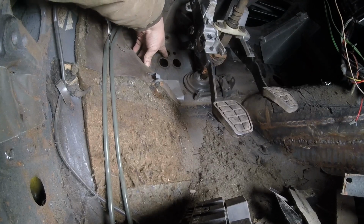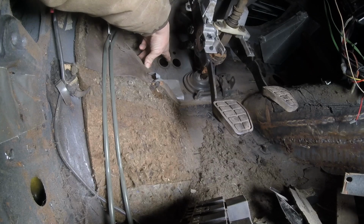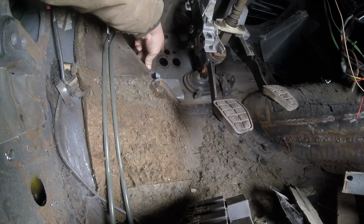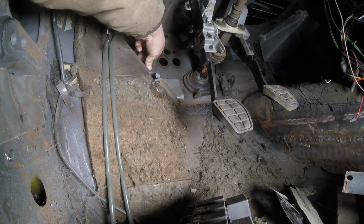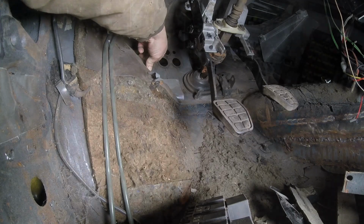First thing, we have to have the clutch master cylinder in here and stable, and figure out what clutch master cylinder we're going to use. Second, we have to have a hole big enough to run the 5 or 6 plugs that come in through the front of the Mark III harness into the back of the fuse box. Let's go over to the desk. I'm going to show you what I'm looking for and some of the information I have on that fuse box in the Mark IIIs.